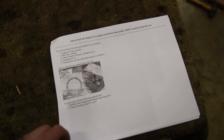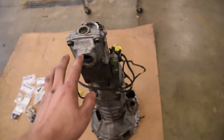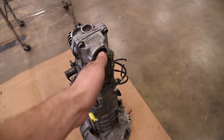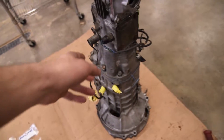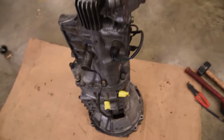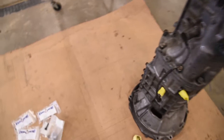I'm simply following instructions I found online from the RX7 Club forum. The first step is obviously to get the transmission out of your car — mine's already been out. Make sure the thing is in neutral when you get your shift lever in there. You don't have to worry about taking all the sensors out or anything like that, but you do need to get this top cover off. Go ahead and loosen all these bolts around — they all use a 14 millimeter. I used an impact with a swivel to make it easy.